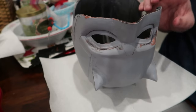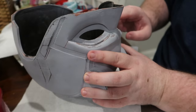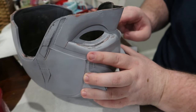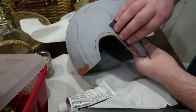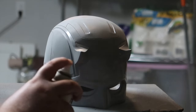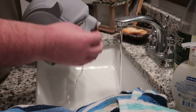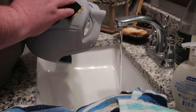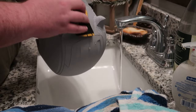There were a few spots I could have sanded and bondoed a little bit better, so I'm gonna kind of start from the beginning and follow all the steps again, just in those small areas. And finally, this time I'm going to have my last round of sanding, and this time will be a proper wet sand with 400 grit sandpaper.